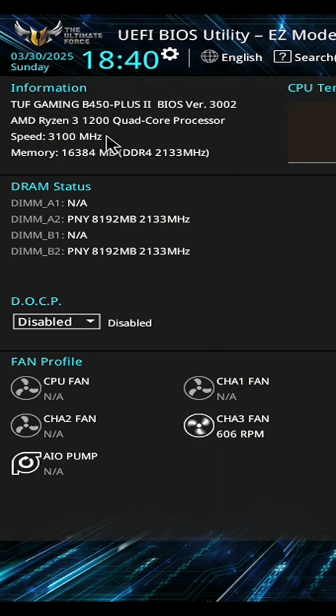The specific motherboard that I'm using for this is the Asus TUF B450 Plus II, but pretty much any modern Asus board is going to be identical step-by-step, and other manufacturers you should be able to do this as well in their monitor — it's just going to look slightly different. However, there still are motherboards out there today that will not fire up without something plugged into the CPU fan header, and those usually tend to be the more low-end ones.